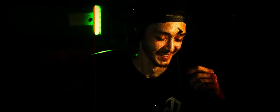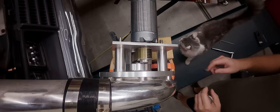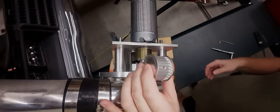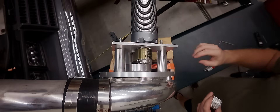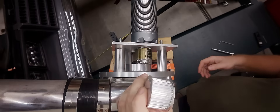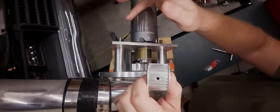This is where the video was supposed to end, but just like the last time we were on the dyno with these electric superchargers, something showed up — a 28-tooth pulley. Up until now we've been running the 22-tooth pulley on this motor. There's an 18-tooth pulley machined into the impeller shaft. This should greatly increase the load and also increase our power potential. So let's do it.